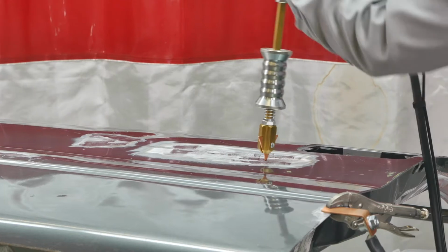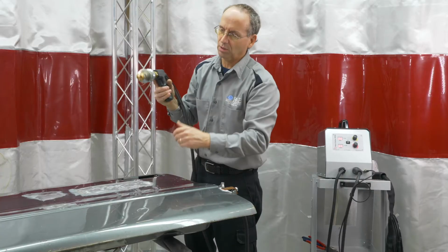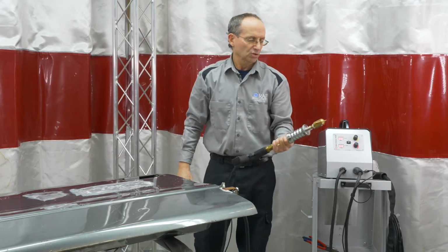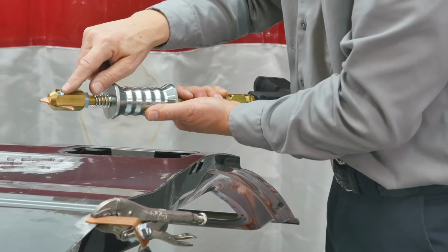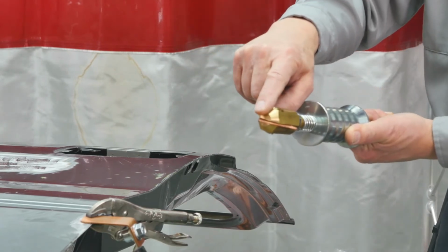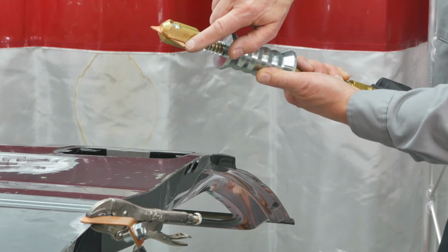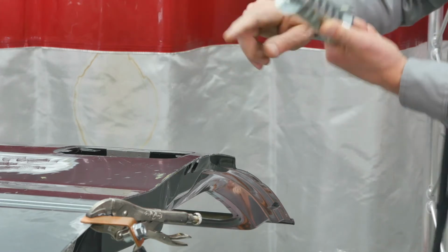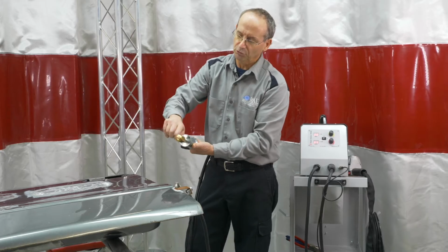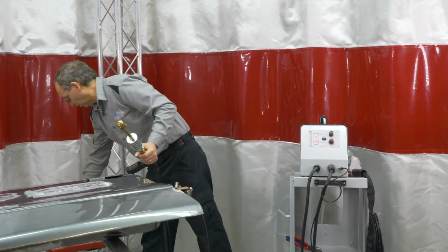So again, then make sure that we're doing well. A little twist, it'll come off. That is the slide puller. This piece is replaceable. A little Allen screw will come out, the little triangle piece, you can turn it. You can also take this piece and reform the tip. All you want to do is just maintain what the original one looks like with some roundness on it, and you get quite a lot of use out of this tip. So we'll take this off.